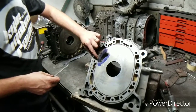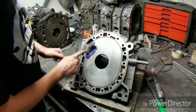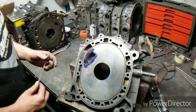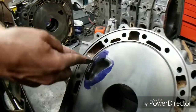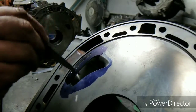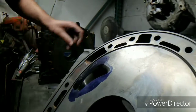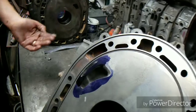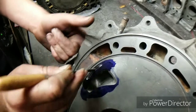After you've done your porting and connected all of your holes creating one continuous port, you might have some rough edges, maybe even some waves. The porting tools can remove a lot of material very quickly. So come in with a little flat diamond file and work your edges flat, just a little bit of back and forth. That way you're squaring everything up without getting excessive on your material. We want to actually ramp it back in a little bit, so we're allowing that air to scoop up into the bridge - working it at a slight angle just helps create the start of that passage.